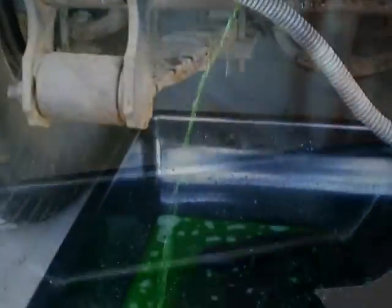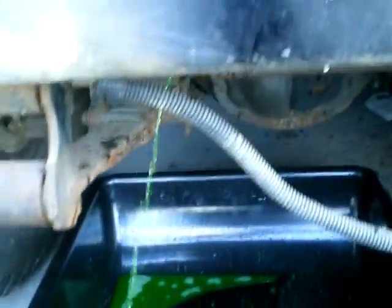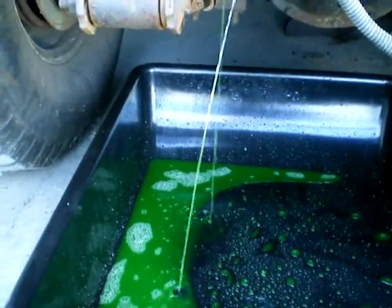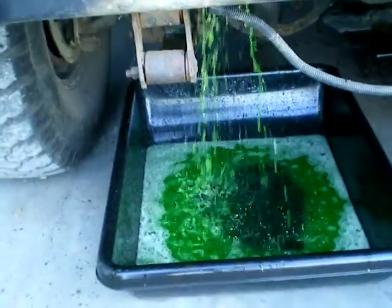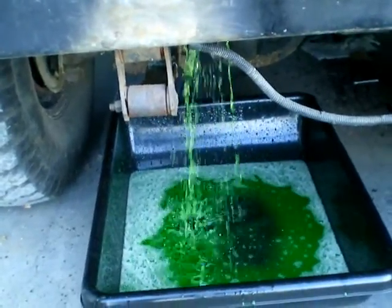Go quick, yank that manifold — and I got it. That's working pretty good. It's in my five-dollar container. I pulled the petcock out, which is just really a plastic piece of junk. I'm going to loosen the radiator cap and that should make it come out faster. Okay, perfect. Looks like there's good radiator fluid in there. Now we'll drain that out and then I'll pull those hoses off the intake. Alright, I took the clamp right off of the intake but it still doesn't want to go.